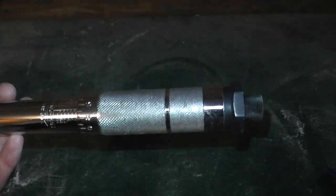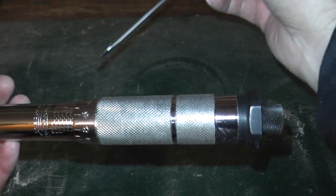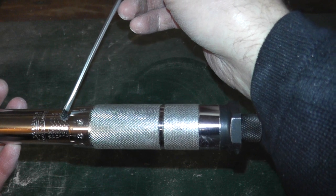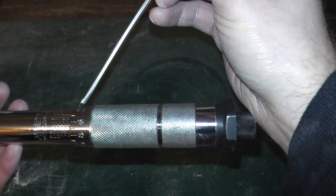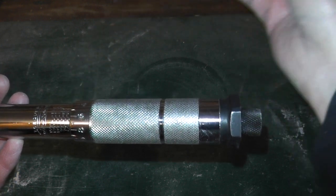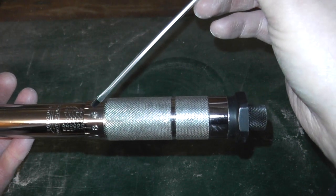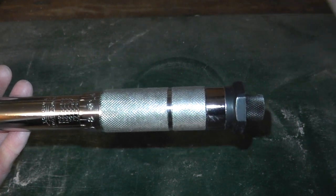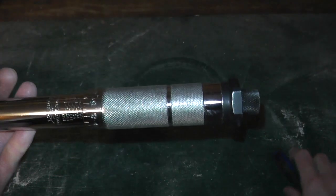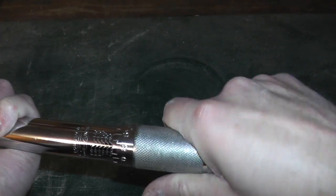In this case, we'll be tightening the wheel, and for this vehicle it's 80 foot-pounds. Find 80 on the scale and just follow the line — 80 foot-pounds is right here. When you purchase a torque wrench you'll be able to see it clearly. There's also a lever with markings at 8, 6, 4, and so forth. For 80 foot-pounds, this lever has to be at zero, and the zero lines up with 80.